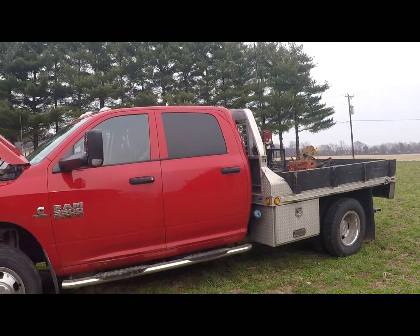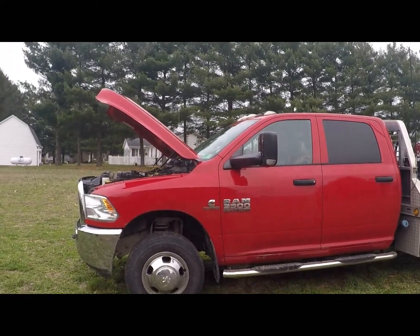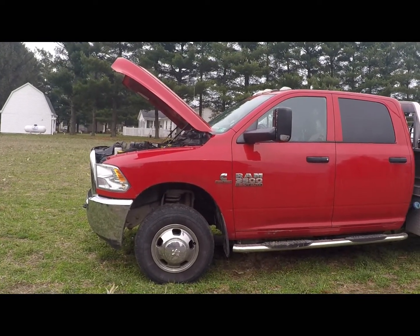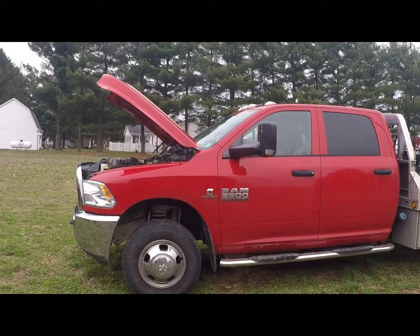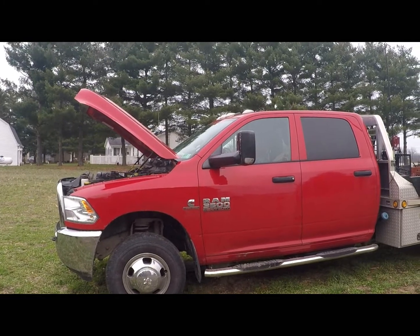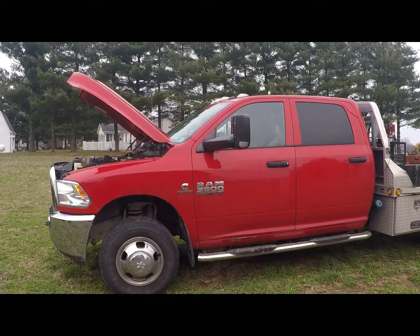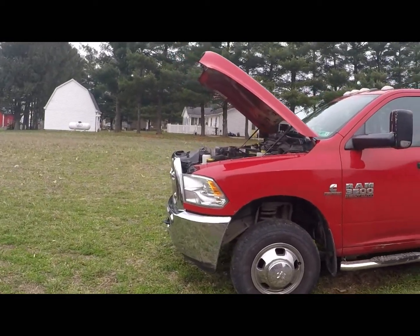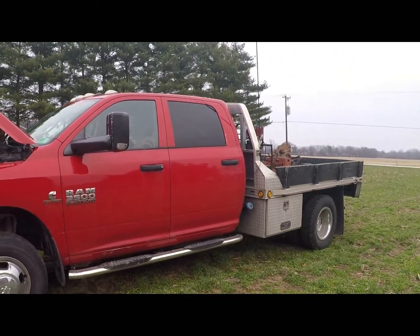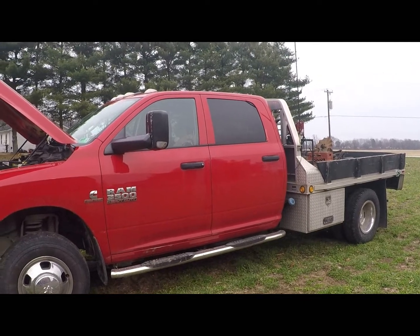It does have some black smoke, as you guys seen. It's not real bad. The torque converter, he's got the torque converter lockup in 2nd or 3rd gear, I think. He got rid of some of the limiters on the truck. No speed limiter now. The cruise control works at a lower range. The exhaust brake works at a lower range. He got rid of the stuff that would put the truck in limp mode. So trying to think if there's anything else that I can think of offhand. If you read his tunes, it tells you what he does.